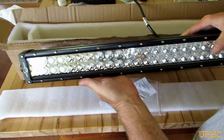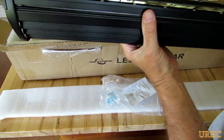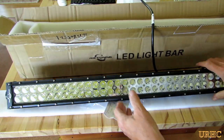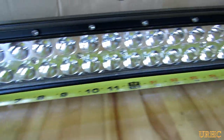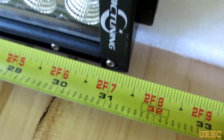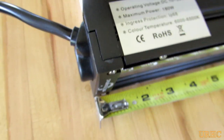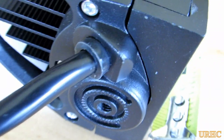It really seems to be well made. The cooling fins are just amazing compared to the other one — really long, heavy extrusions — so it looks like it's going to be a long-lasting unit. The overall width comes in at about 31 and a quarter inches. It's rated at 6000 to 6500K, so it's got good light quality — a bright white light — and it's got a nice strain relief for the cable.